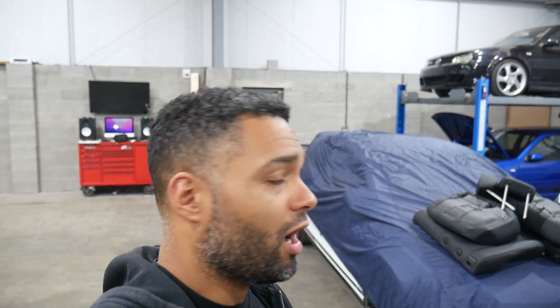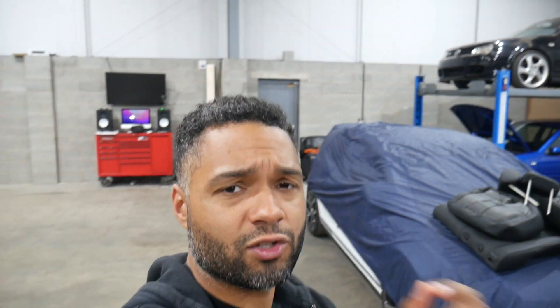So we've got a Haldex controller now because that was missing. I don't know if you can see over there, but the rear of the car has dropped down - we've got an air leak on the rear bags. I'm assuming that's the rear lines because they go through the body frame through a small hole I drilled, and I'm thinking maybe it got caught on some metal and split. It takes about 12 hours to fully go down. We also need to run the wires from the boot to the battery, because at the moment it's just loose in the boot.